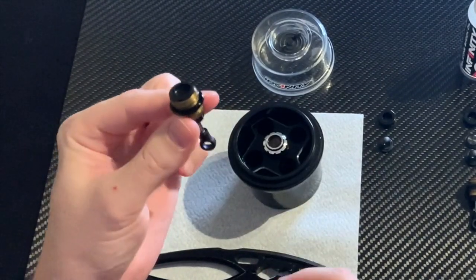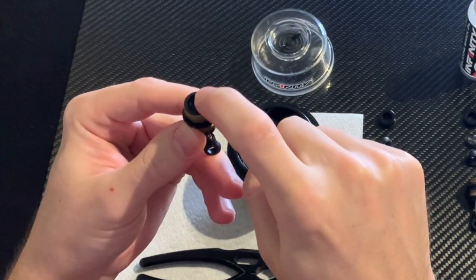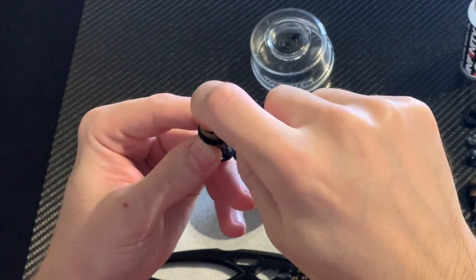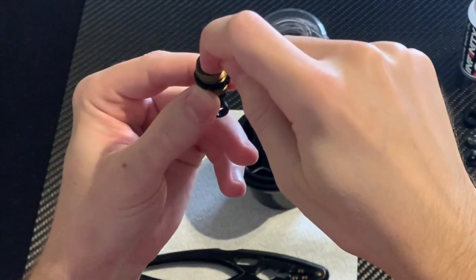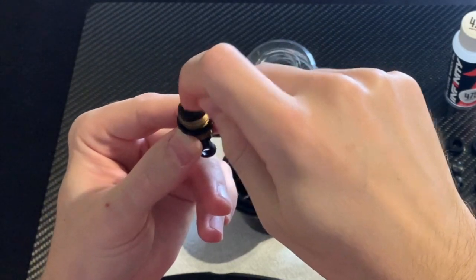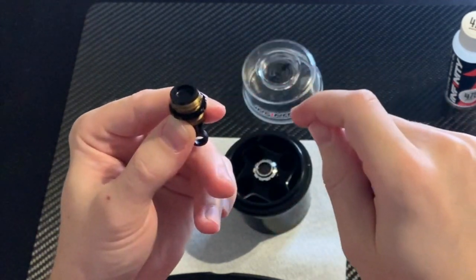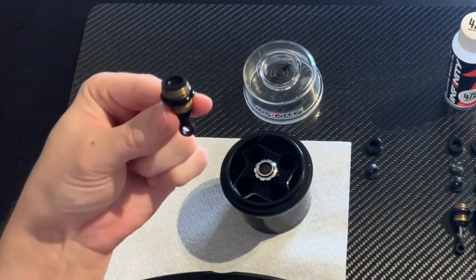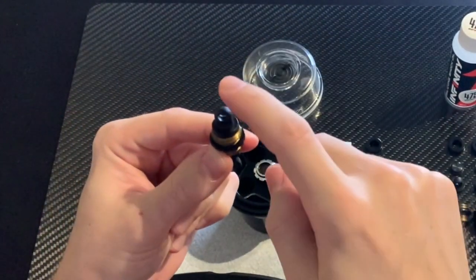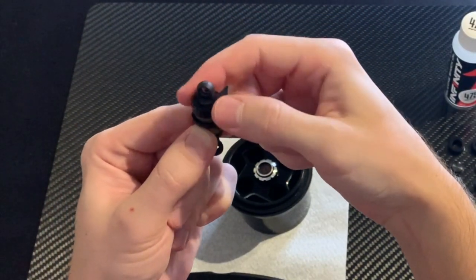What I like to do now is push the piston all the way up. I hold the membrane a little bit and push the piston very slowly all the way to the top — you can see the oil is going out. Then I like to push the membrane down a little bit and remove the last bit of oil. This way we make sure we have no rebound when we push the piston up. Put the top piece on — the top screw body — and screw this one in.